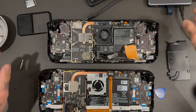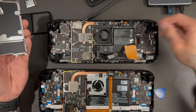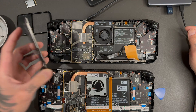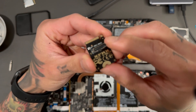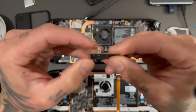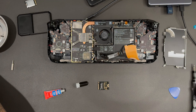We do have a MOSFET underneath. If you look at this one, there's nothing in this thing, so technically we don't even need to put the backplate back on — none of these components are getting cooled by it, they're all just more robust and heavy duty. I'm going to just raw-dog it. But first, this connector scares the crap out of me. Considering these have increased in price quite a bit, we're going to fortify it with a little bit of super glue — which is non-conductive.